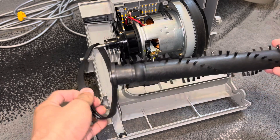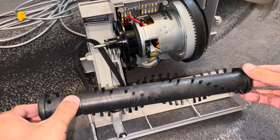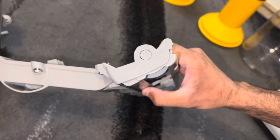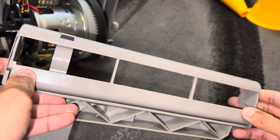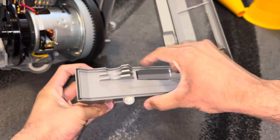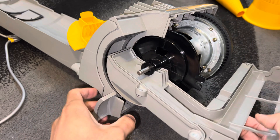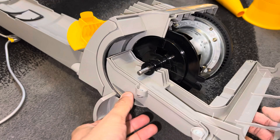When the motor spins it turns the brush bar with this belt. You'll notice the bristles are in a spiral shape — this allows dust and debris to be guided into the suction inlet right here. There's a pivoting sole plate design so it's designed to stay in contact with the floor at all times. Suction airflow comes into the base of the sole plate and goes up this tube — this piece of ducting right here — coming out the opposite end of the sole plate and mating up with this huge opening right here.